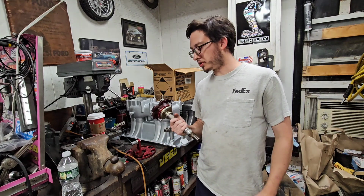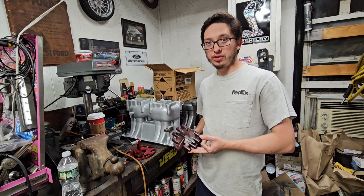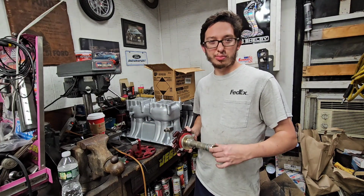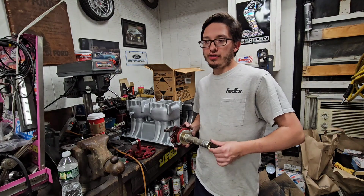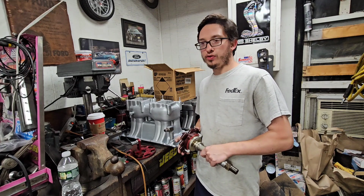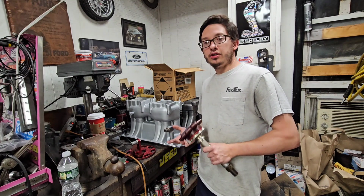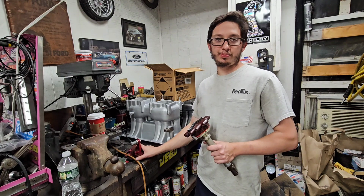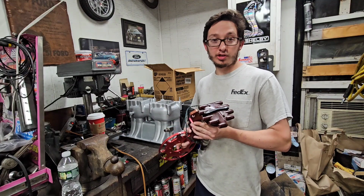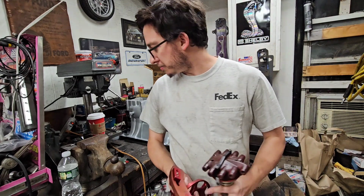Now, the reason I did this was I was going to buy an ignition box, a coil, and a distributor. The distributor that I would want, like a Pro Billet, even used, goes for about $250 to $300. New, they're over $300 for a nice Pro Billet small block Chevy distributor from MSD. So to me, this was basically as if I was buying a nice distributor. I did get a nice distributor out of it, just with a crank trigger. So, there's that.